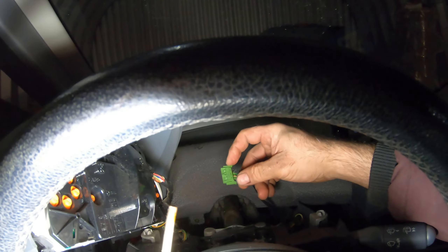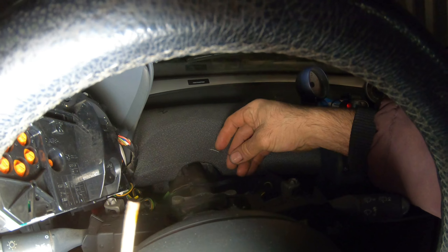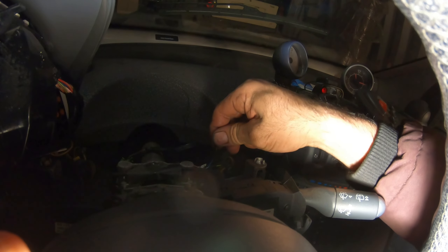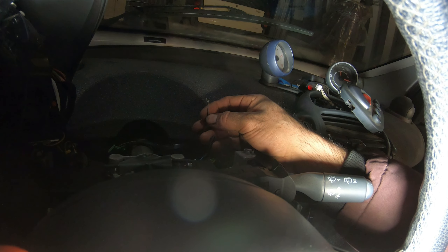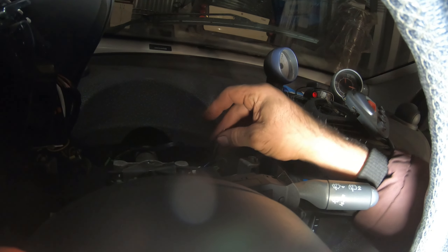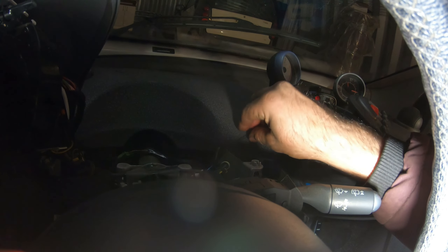Here's the connector — it just plugs into the back of the dash pod — and then there's the single wire that came with it, and that just ties into this blue one here. That little blue one might be bundled up with the rest of the wires; you might have to untape it and put it together with the single one. I've seen them with a splice from Mercedes on it — you'll see a little red dab of glue on there and some tape around it. That's all it is — a splice, not a resistor or anything like that.